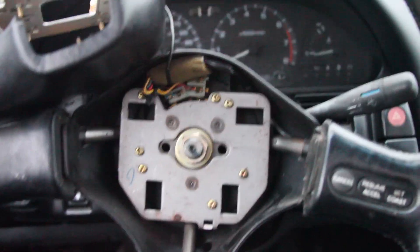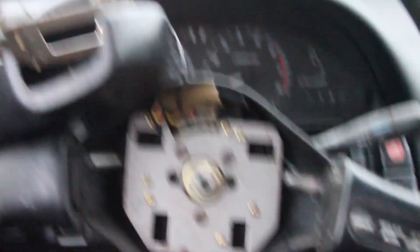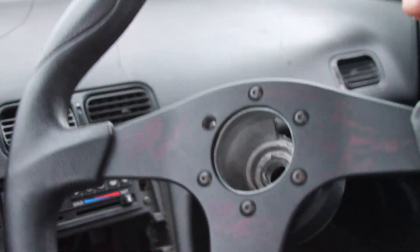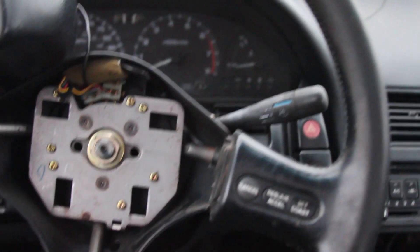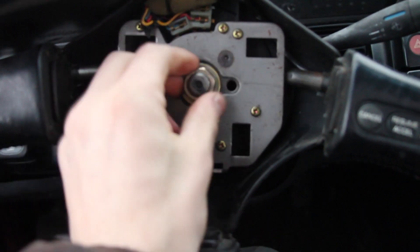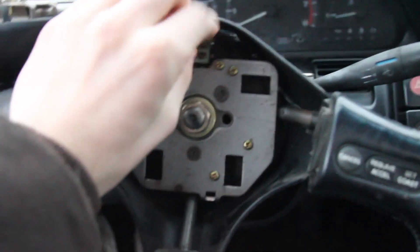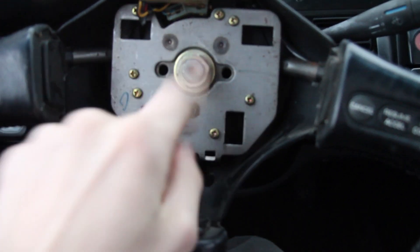And then you guys can hear this thing run a little bit more. So I'm in here in the car changing the steering wheel. This is the stock wheel, and this is what I'm putting on — it's actually signed by Haggard. Basically you just pop off the center piece for the steering wheel where the horn is, and then you unbolt it, snip these wires because we don't need cruise control or a horn since it's a drift car, and unscrew this bolt and the whole wheel should just come off.